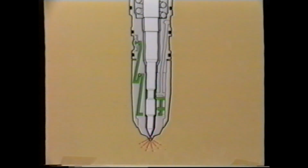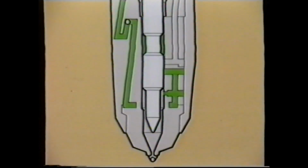This feature avoids any possibility of fuel being left in the injector, which would result in a carbon buildup in the cup. You should be aware that if the injectors are not set correctly, they will affect the fueling of the engine. If the pushrod is slack, this will cause black smoke, because the injector, when collecting fuel prior to injection, will be in the fueling position longer than normal and collect more fuel.